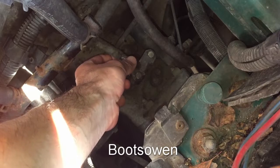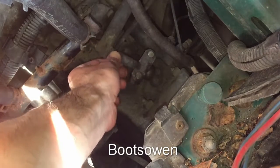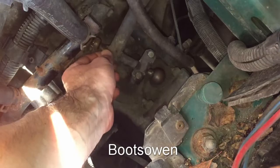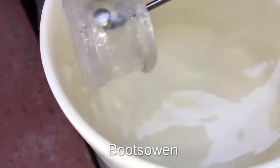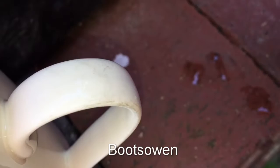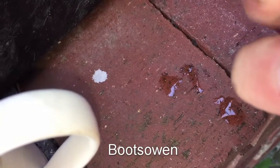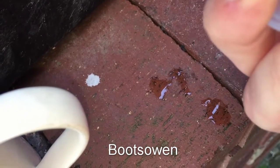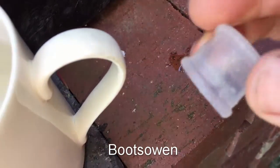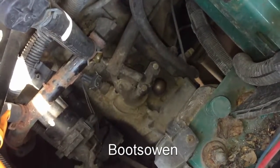I don't know what that looked like but I can see that the ball has come right over to the left. On the gear stick end it just had complete slop going left to right — up and down felt positive enough but left to right it was just going all over the place. So I put it in a cup of boiling water — it just turns to jelly straight away. Actually it looks like it's deformed the rubber a little bit, which isn't great. These were only about three quid but if it can't take hot water what sort of silicone thing is it?